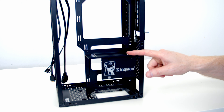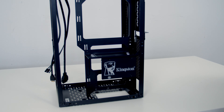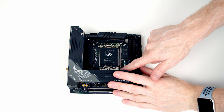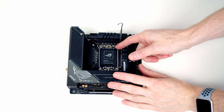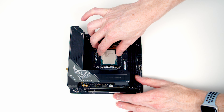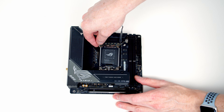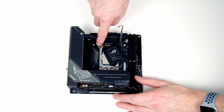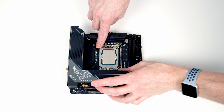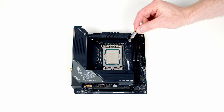We've got a really large graphics card that needs to go in vertically, so I'm going to put this back to the stock configuration. We're now ready to start working on the motherboard. First, push the CPU socket lever down, out, and all the way up, then open the cover. Set the CPU into the socket, lining up the notches at the top and bottom with those on the socket and making sure the text is the correct way up. Close the cover — apply a little pressure and the plastic will pop off. Close the lever all the way down and back under the clip. Next we can install the backplate for our CPU cooler and screw one of the standoffs onto each corner.